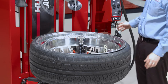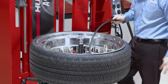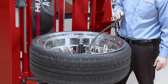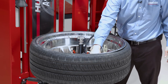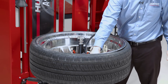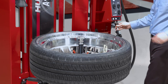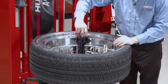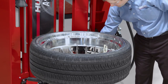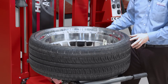I can do a double tap on my indent buttons to clear the tools. Inflation is standard — the same process. I don't need blast on this particular tire. Anything in excess of 40 psi to seat the beads means you'll need to use an inflation cage. Just like that, without any issues at all, I've got this fairly difficult assembly changed with absolutely no issues.